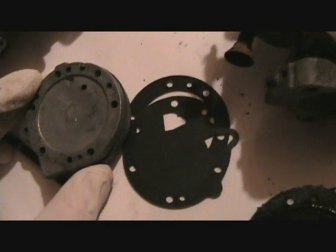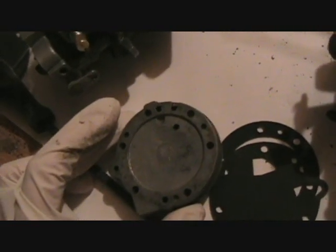Here's the problem — this seal. If we look here and flip this over, it's not there. So where in this carburetor is it? It's probably somewhere down near the bottom. That's what I'm going to find out. That may have been the only problem, because the '69 Olympic would fire up and run nice, but then there was no gas to keep her going.